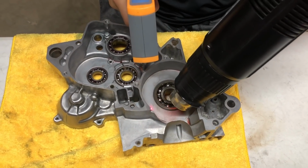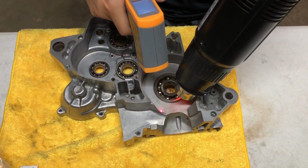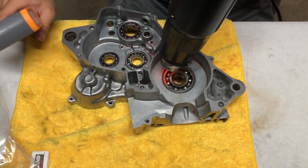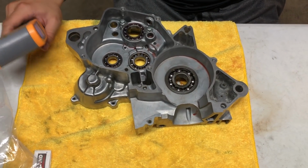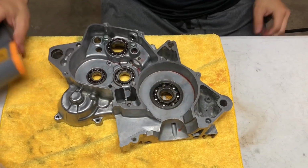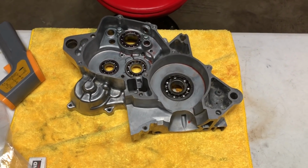Basically what I'm doing here is I'm taking the heat gun and I'm heating up the right side case. So we're back on the right side case and I'm heating it up and it's about 200 degrees, so it should be ready for the crankshaft to slide into. The reason why I'm putting the crankshaft into this right case is because the manufacturer specifications tell us to build from the right. As usual, I'll put the heat gun in the description, but if you don't have one, you can just pour water on there, and if it boils, then you know it's hot enough.